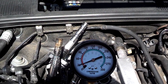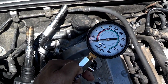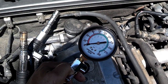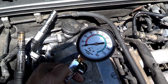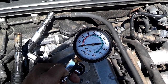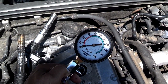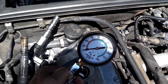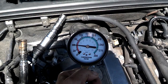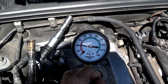Cylinder 2, the highest compression on it was about 30 PSI. Cylinder 3 has no compression, or maybe 10 PSI. When you crank the motor, you're supposed to hold the throttle down at wide open throttle to help it get all the air that it can. Also, you're supposed to have the fuel injection and ignition system disabled, and you should do this with a remote starter so you don't run down your battery — but this is just a quick test, no big deal to run it off the car battery. The 4th cylinder had about 60 PSI. So it looks like this head gasket is blown across the board.